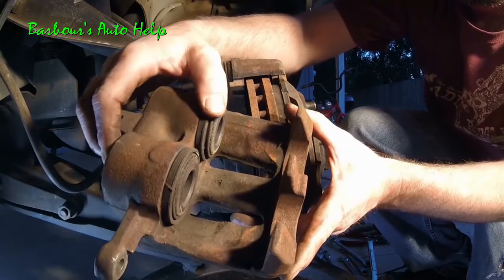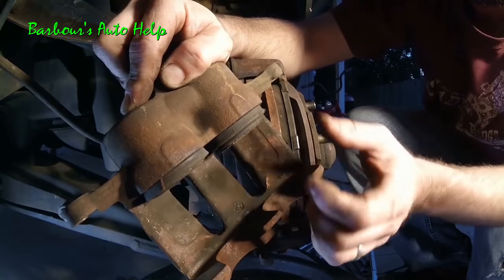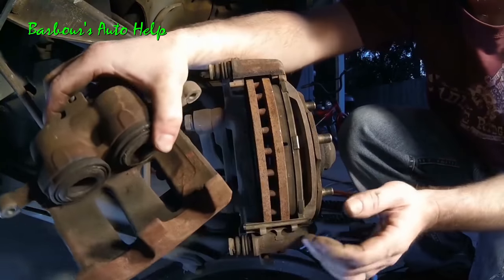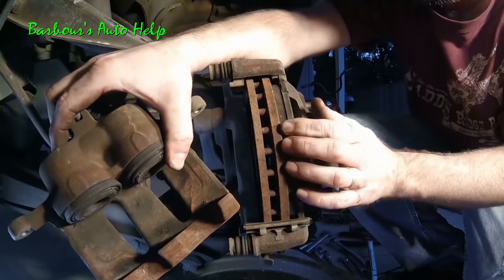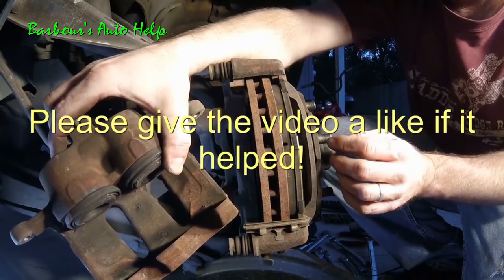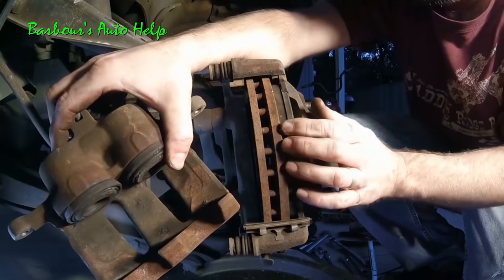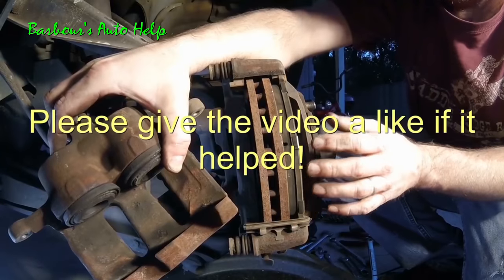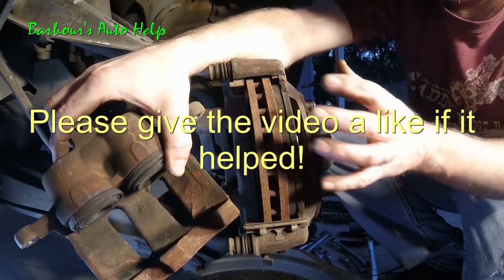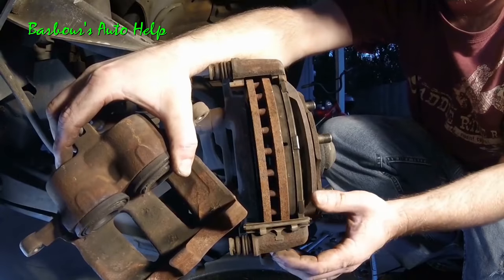So it's the caliper we need — this piston right here is the one that didn't collapse; you can see it's still pushed out more than the other. Now you saw how my wheel was smoking earlier. These brake pads got really hot, and in reality I should be replacing this rotor and also the bearings inside. But like I said, it's an emergency repair — I don't have all my tools here — so I'm just going to replace the caliper and go with it.